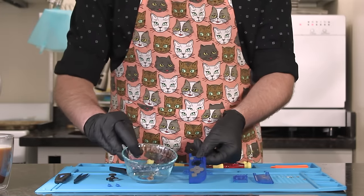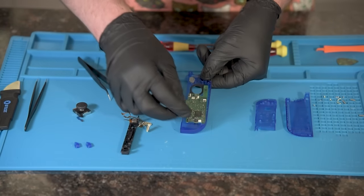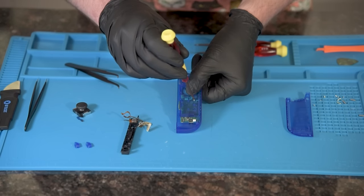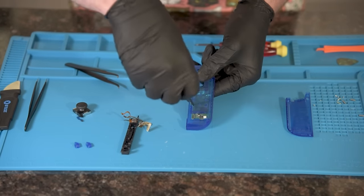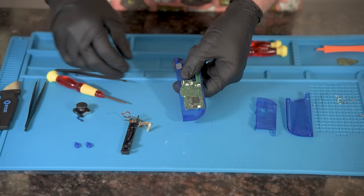Open that cabinet again and get yourself a good looking side rail. And while you're at it, get the logic board. Place the logic board over the buttons, shiny side down. The only screws we're going to place right now are the two that don't interfere with the second layer. Go ahead and check the buttons to be sure that they are functioning correctly.